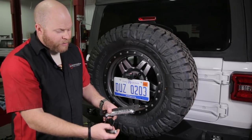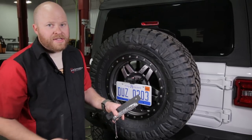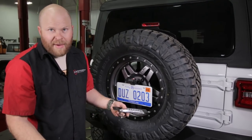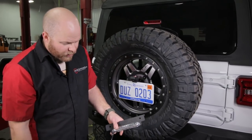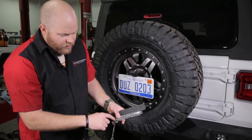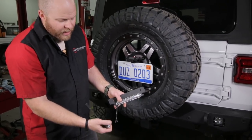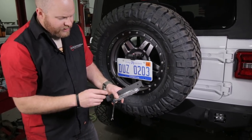We're going to provide you with this third brake light - a nice LED light. It's for our tire carriers, but if you want to use it now it's fine. Just unbolt the factory light and we can start to bolt this together. We'll give you some button head bolts tightened with a 2.5 millimeter hex wrench and a 7 millimeter box end wrench.